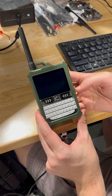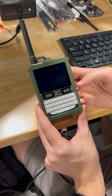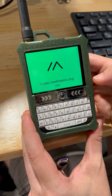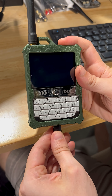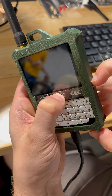If you want to update the firmware on your Spec-5 Ranger or Ranger Magnum, follow these steps. First, plug your device into your computer using a USB-A to USB-C cable. Next, press and hold the middle scroll ball while turning the device on from the off state.